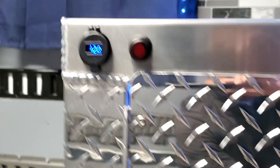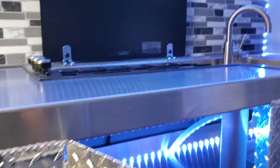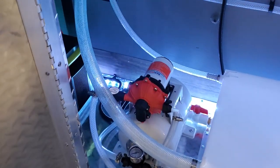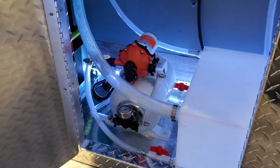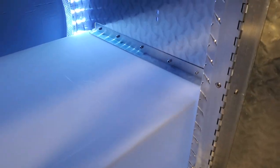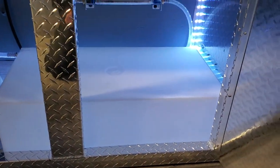On this wall there's a voltage indicator with USB ports, and next to it is the water pump switch. Over here is a Sea Flow water pump — it's a 60 PSI pump regulated down to 45. There's also a two-gallon accumulator tank so the pump doesn't kick on all the time; the pump barely ever even runs and when it does, it's very quiet. There's a 26-gallon freshwater tank secured with L brackets so it cannot come out from trailer movement or bumps in the road — you can slide it out from the left side but it won't come loose on its own.